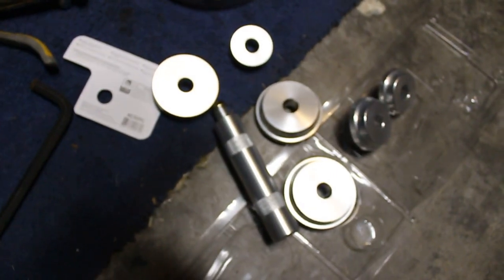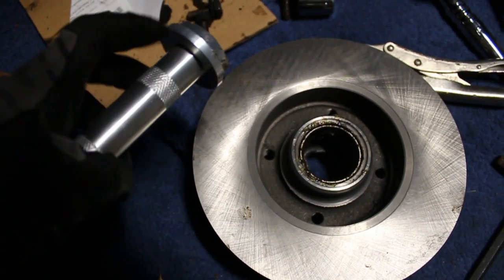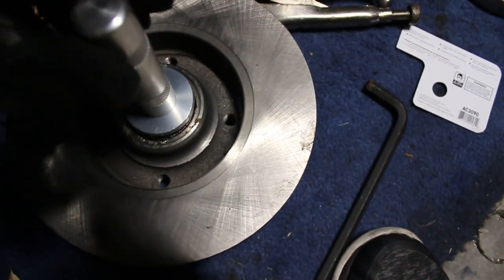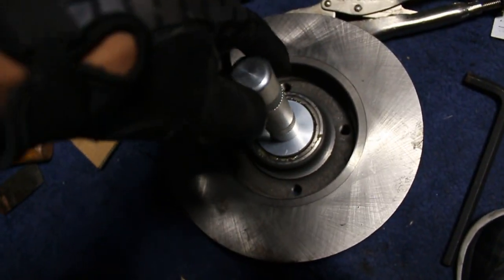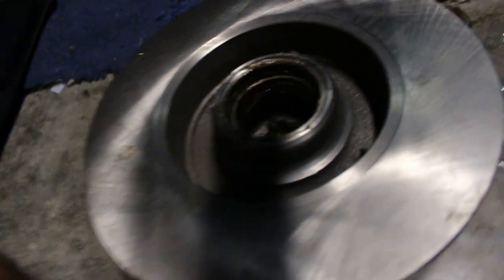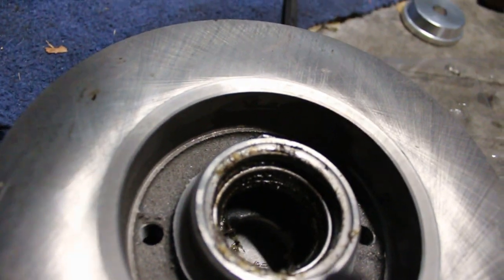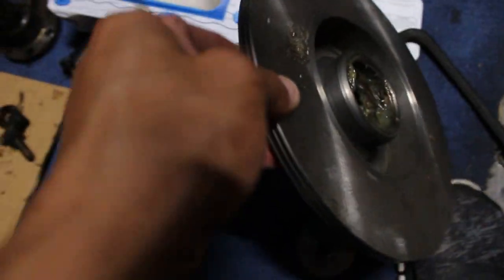Easy as that - you just hit it. Here's my setup - got my little handle piece, this is the size that fits perfectly inside my race. Set it like that, hit it with a hammer, and it should go in. Had to smack it pretty hard, but if you look in there - boom - race has been seated. Let's continue with this swap. Front races are in, we've got some new grease in there.